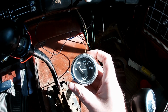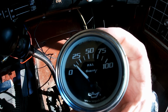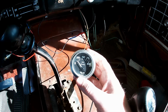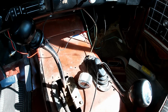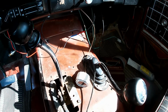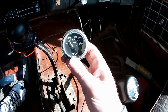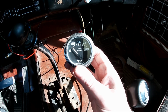We've been running about 17 minutes now, and you can see we're just barely off the needle. Now that it's hot, right now I'm really not hearing a lot of the clattering noise. Again, it comes and goes, but gets a lot less frequent, and then all of a sudden it'll just start. I can still rev it and get it over 30 psi.